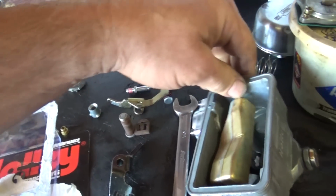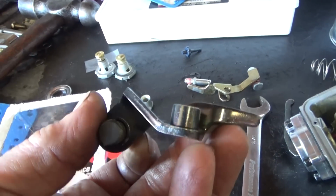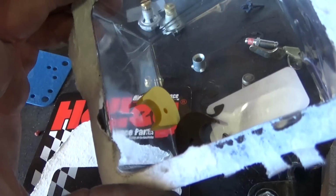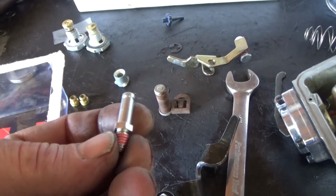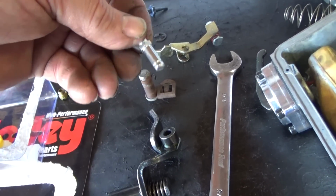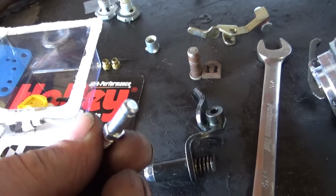Alright, we've got our new 50cc pump body installed. The old stamped arm gets replaced with this twice as big stamped arm. And we're going to go to a yellow or a brown cam, which is what comes with this kit. That guy doesn't look any different size than the old one, does it? Unless it's wider, the new one's wider than the old one. Check that, but if there's wear on that, obviously you would change it. This carb doesn't really have much wear on it.